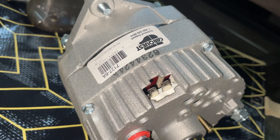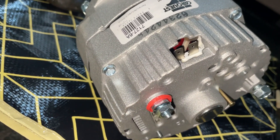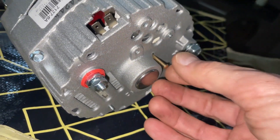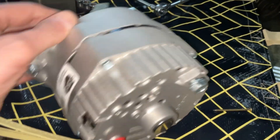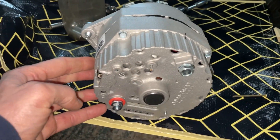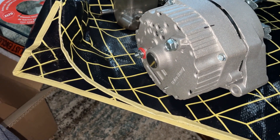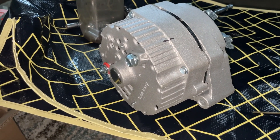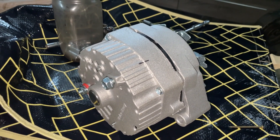Here's the top mount. Now we have the connection for the regulator right on top where I wanted it, and the connection for the output right where I wanted it — so we're good to go. All I need to do is pull out the nail and we're all done. That's how you re-clock an alternator. So if you're at a swap meet or a junkyard and you see an alternator that doesn't look quite aligned, you can buy it anyway and just fix it this way. Hope you enjoyed this and found it useful. Have a good day.